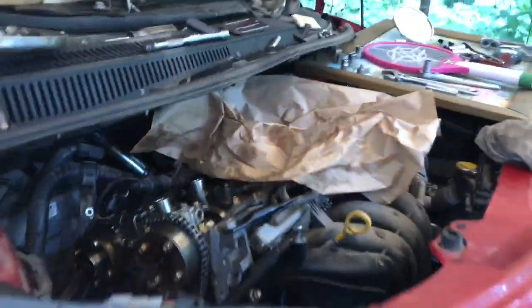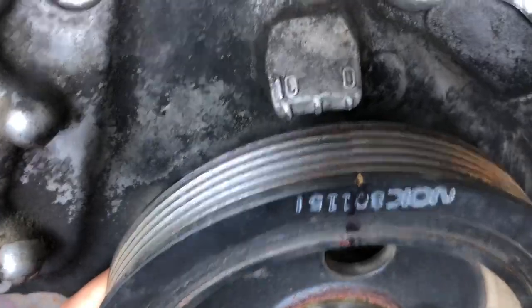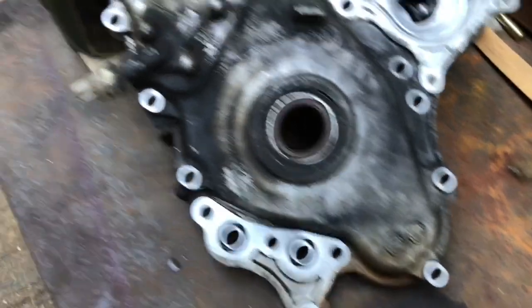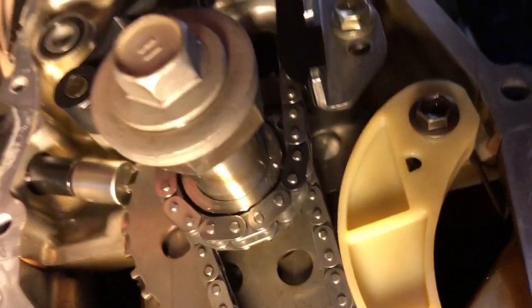We're looking good for the cover going on. The keyway is pointing pretty well straight up centerline — the keyway on the crankshaft snout. That's important because it indexes the sprocket, so you can't just move the sprocket a tooth; it's attached to the crank and must hold that position. If you position this with the keyway straight up centerline, your timing mark is right on zero, which further confirms the position of the crankshaft sprocket. You can see the discolored link in the chain next to that dot on the sprocket, which is indexed to the crankshaft.